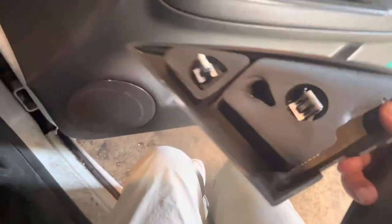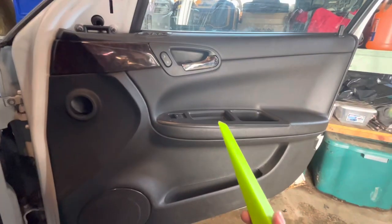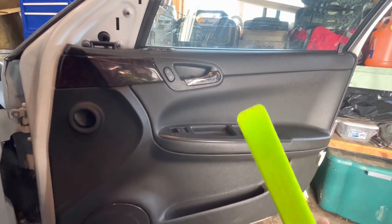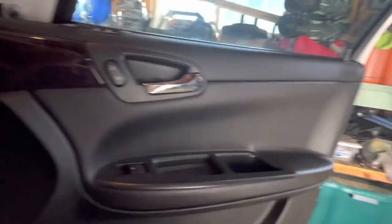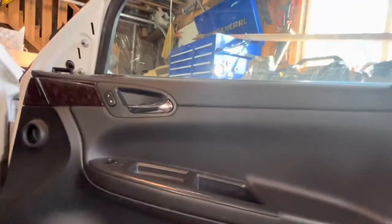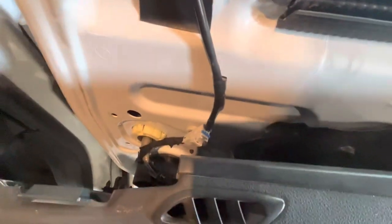She pops right off — it's held in with metal clips that just slide into slots. Once you get all those screws and that cover off, you want to take a wedge or a door panel removal pry tool. I always like using a plastic wedge — it just works better. There are clips all the way around the door, so once you break one or two free, work your way around. Then slide the panel up over the lock handle.